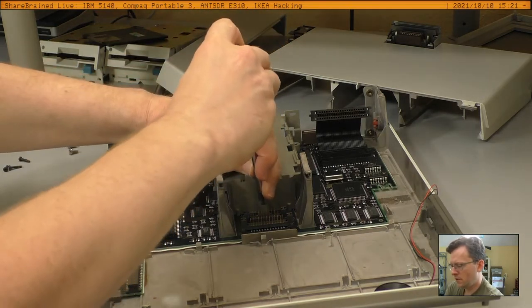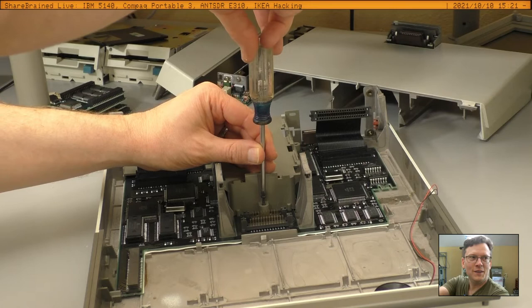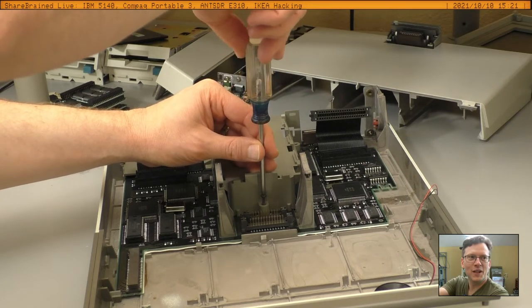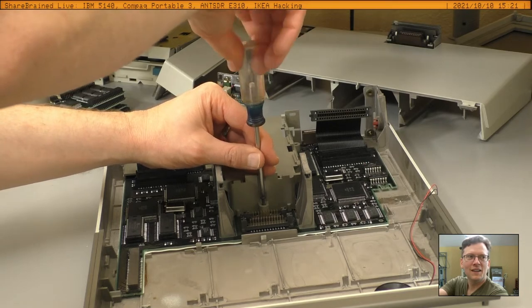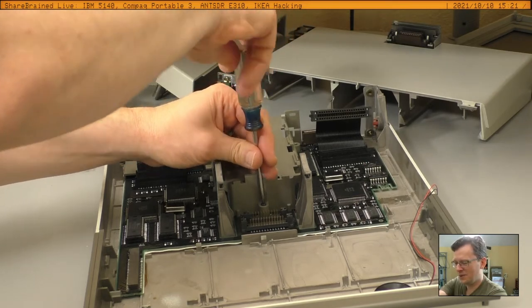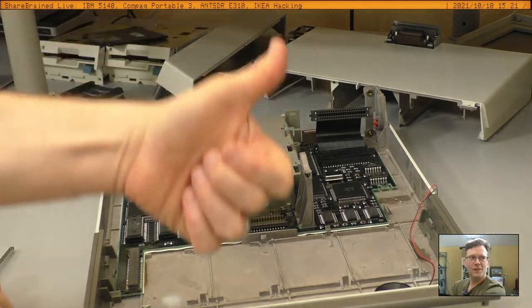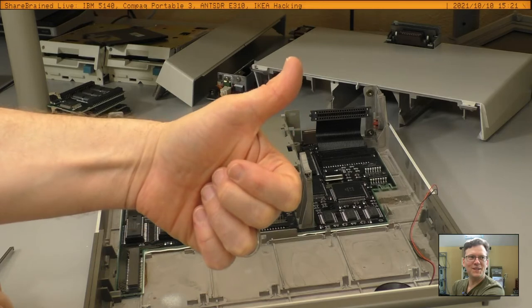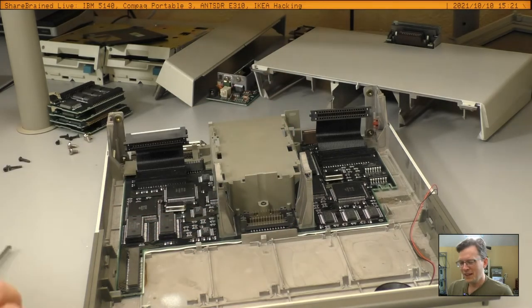which will go, always do the Fran Blanche method. Back out a little bit till you feel the click when you're driving plastic screws back in place. And then start screwing it back in. And that way you won't double thread the hole. All right. I guess I'm stealing something from Adrian. I'm sure other people do this too, but